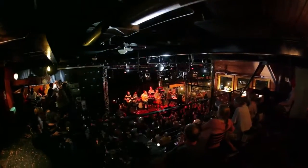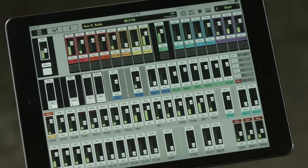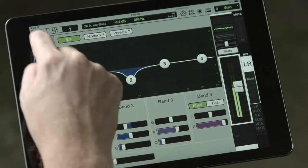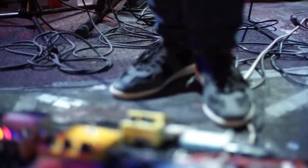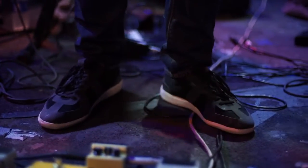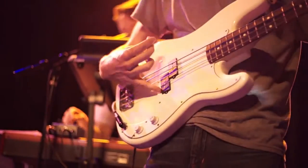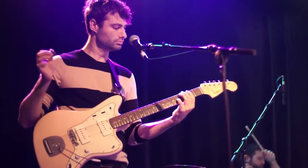The DL32R also features six VCAs and six mute groups, which are critical when mixing large channel counts. All I/O is completely routable, including A-B sourcing per channel, letting you customize the I/O for each venue and usage. Having all of your input, output, and onboard processing 100% in the box is a fantastic feature — this entirely eliminates the need for costly and bulky outboard equipment and processing, with access to all functions 100% via the control surface of your iPad.